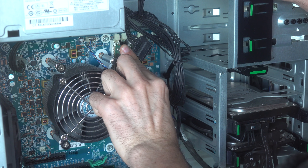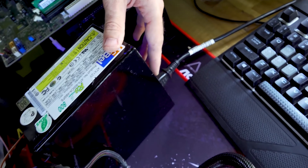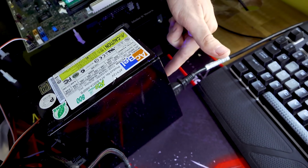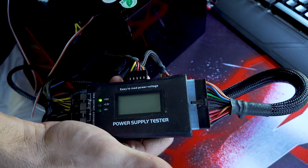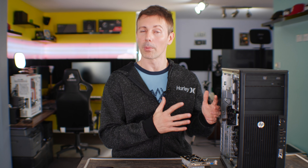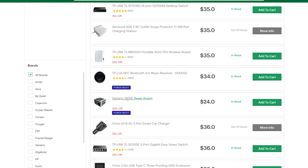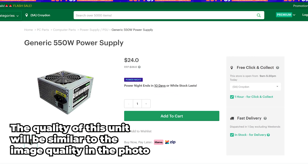The last problem is, in my opinion, the rarest I've come into — where a power supply is faulty but it passes all the power-good tests absolutely fine. All the lights light up, the power supply tester shows it should be good, but then you boot it up, get stuck on Windows, things freeze, and things just don't work properly. Typically if you have a faulty power supply, things just won't boot at all or you won't make it to the BIOS screen. If you do have a faulty PSU that isn't showing initial symptoms, it can be worth swapping — especially if it's a no-name brand or a very cheap power supply. I always recommend getting a decent power supply from a reputable manufacturer, especially if you're serious about gaming.